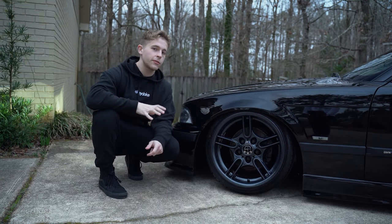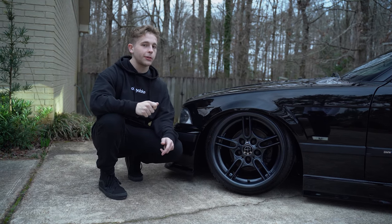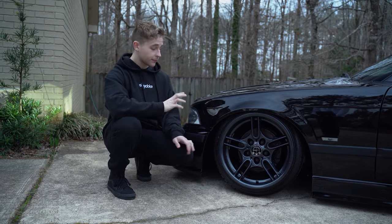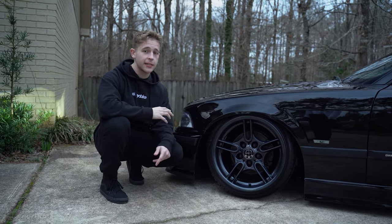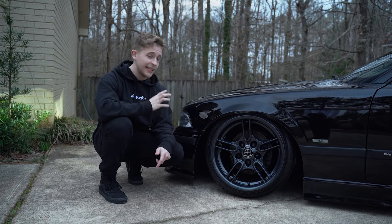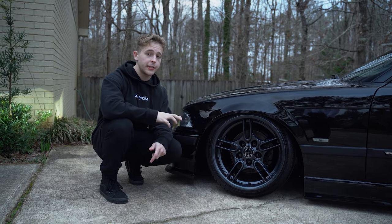What that essentially does is it will just basically tilt the coilover more. So it sounds really sketchy, but it's really not. You're gonna have to use longer bolts to make sure you get proper thread engagement and torque them to spec, but it's really not that bad. I have 5 washers in here, which is a little ridiculous. 5 or 6, I can't even remember. And in hindsight, what would have been a better option was to just go ahead and convert to E46 control arms.